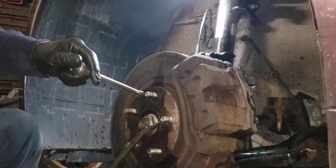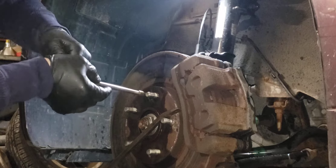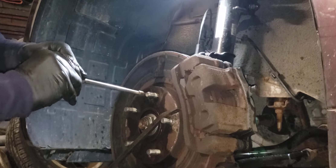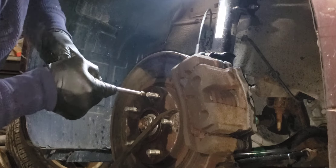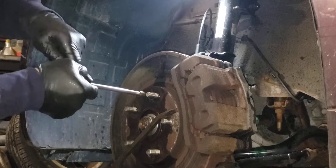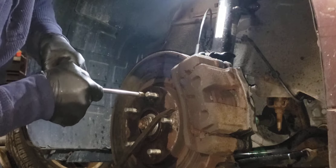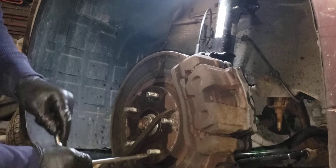You may have to use this to hold it and turn it — just kind of stick your leg underneath there. You don't want to snap it off or you'll be cutting the rotor. This is if you don't want to use a torch. I'm going to try to tighten it, trying to work that PB Blaster in there. I felt some movement — that's why I hit the rotor, to vibrate it and break it free. It's a little ratchet so you can't get a lot of leverage. You have to watch because you might think it's coming but what's actually happening is the bolt is twisting.